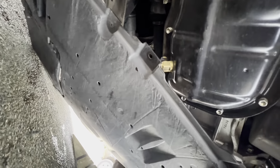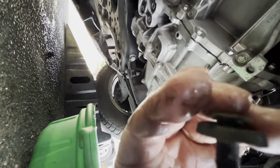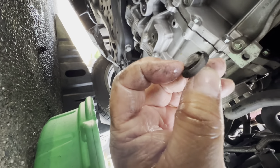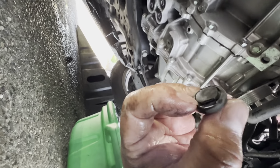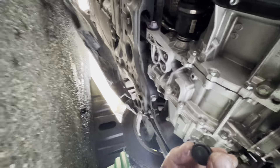Put the covers back on — pretty easy to take off. The screws are all pretty visible. For the plastic clips, I just used a little screwdriver to pop out the middle center. You pop out the middle piece first and then pull it out — put the flat head screwdriver in there, pop the center out, and then the plastic clips all come out.